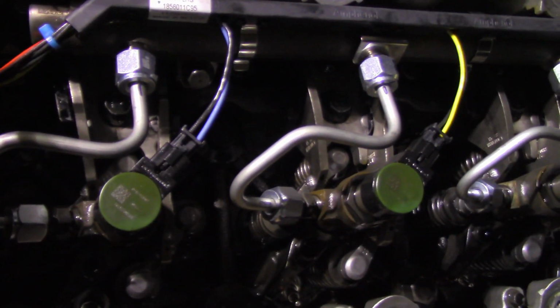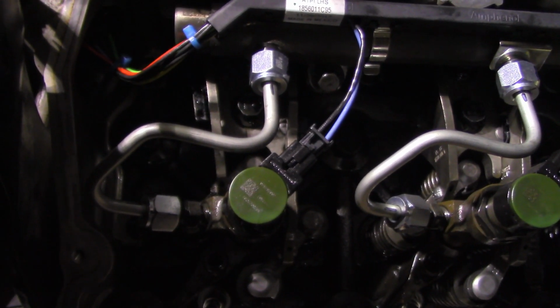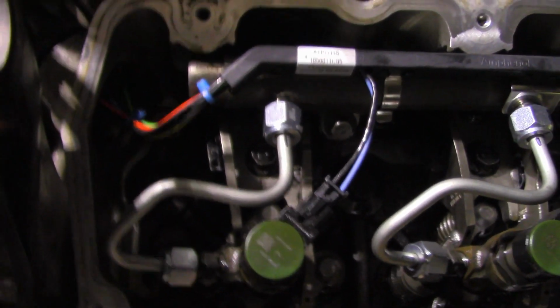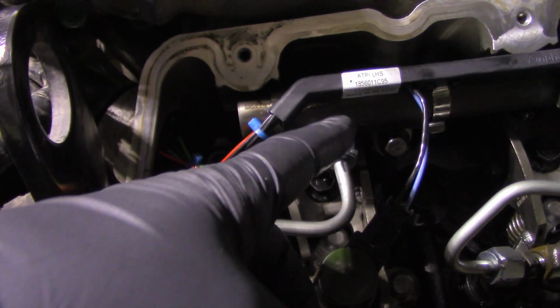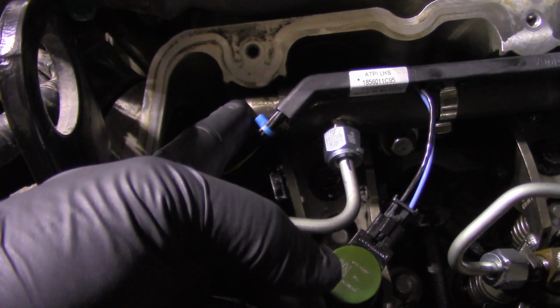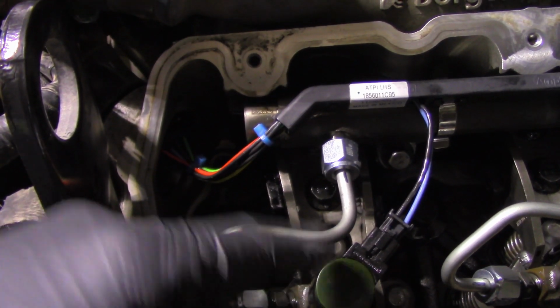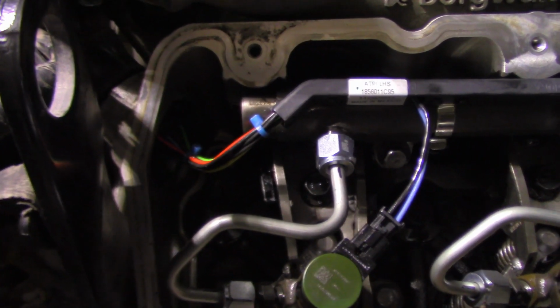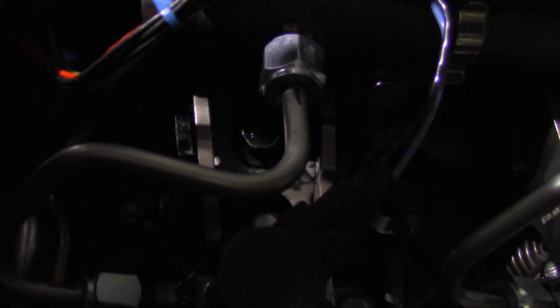Alright, boys and girls, I'm going to try to do this without any kind of stabilization on the camera, because I just can't fit the tripod in here. But so we did the, oh, I keep blocking my own light. We did the fuel harness here for the fuel injectors. There's little C-clips that it clips onto the fuel rail, which we replaced. It's that rail right there. We replaced the rocker arm assemblies, which are underneath here and torqued. They basically look like blades, I guess, would be the easiest way to describe them. There's 2 bolts on the rocker arms.